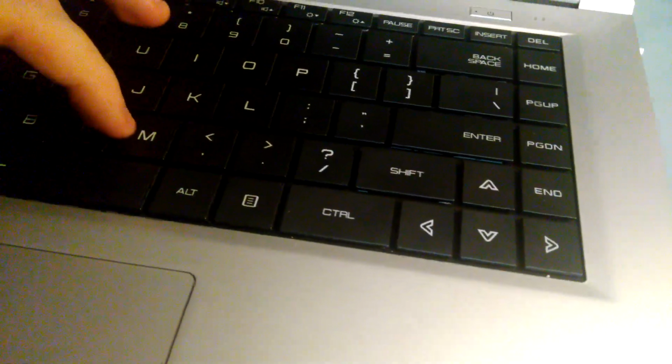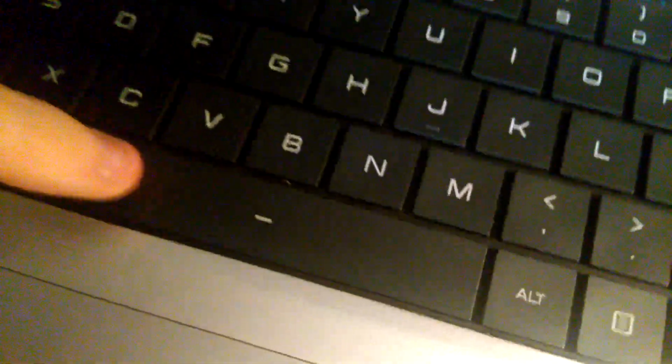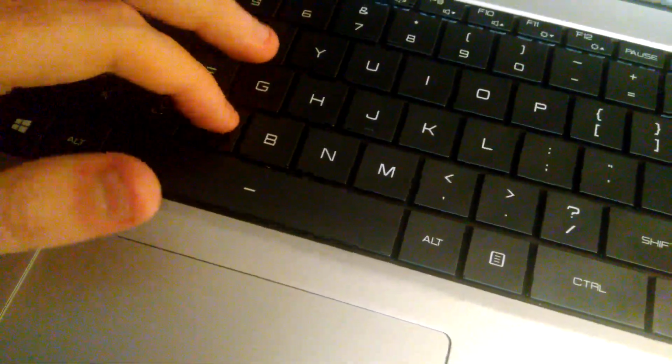The issue with the keyboard is the design, where stuff can fall beneath the keys and it will actually stop your actuation. I had some plastic printer filament fall in here, and it stopped my keys from pressing down. You can see there are some scratches under there where I had to dig with a paper clip and some pliers to get this plastic out of my keyboard.